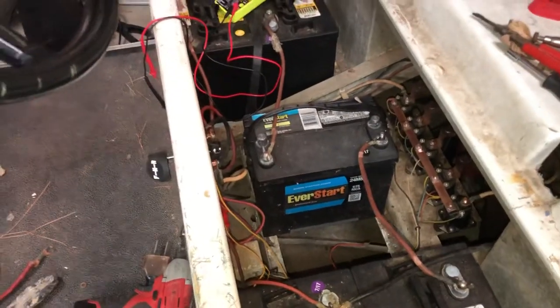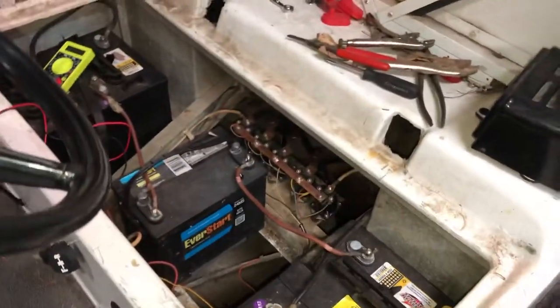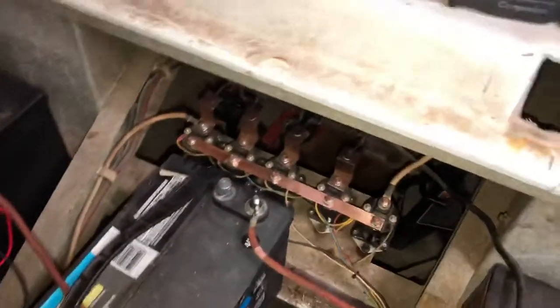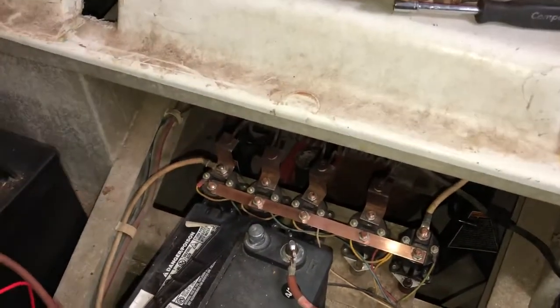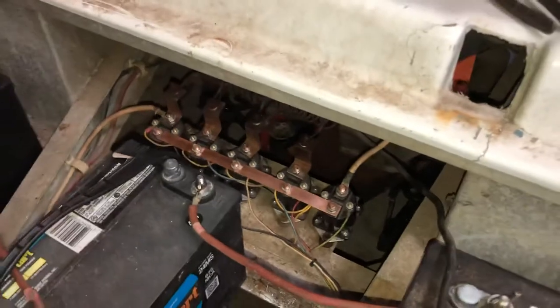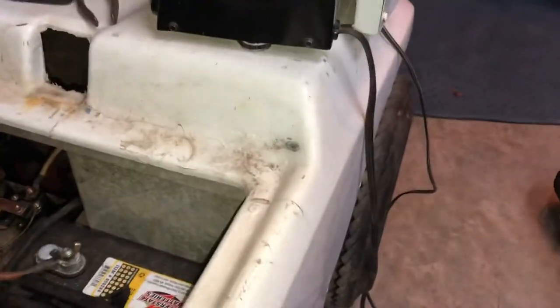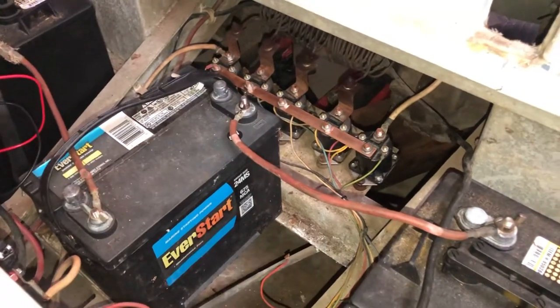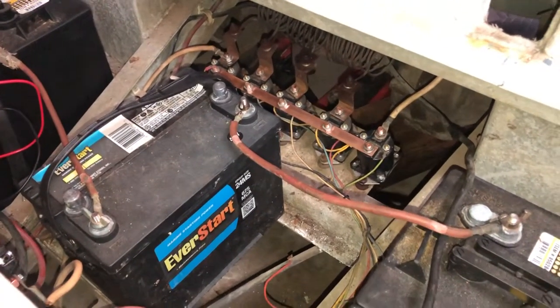Yes, I know that's a boat motor. I've replaced all the solenoids. The speed control is old but the F&R switch replaced that. When I put some voltage directly on the motor it is turning slightly, but the issue is it's not putting any current through the solenoids from the batteries.